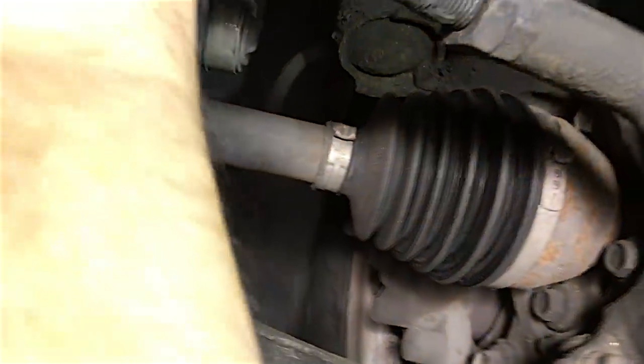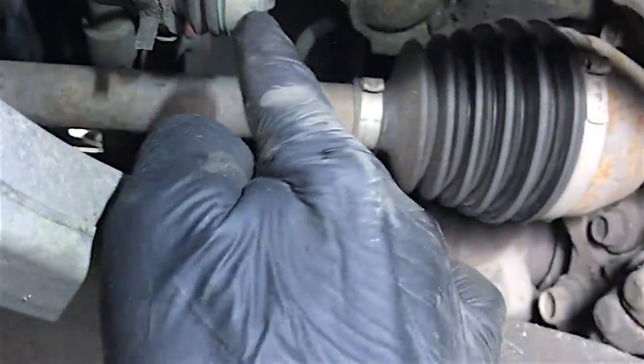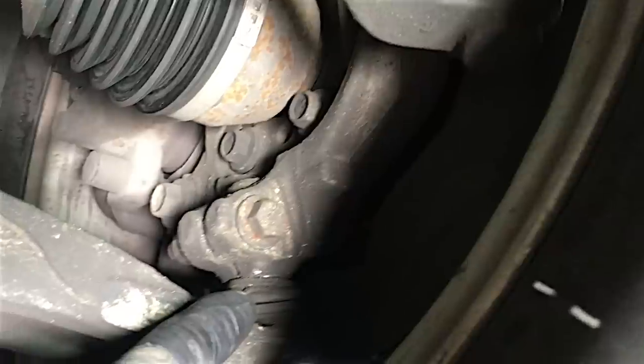Anyhow, I'll get back to the suspension. Things like track rod ends, get your hand on them, give them a good old pull up and down. The same with your anti-roll bar. Pull the anti-roll bar up and down to make sure there's no play in here. Have a good check of the nuts and bolts, the bushes, the dust covers. Make sure everything looks like it's in place.